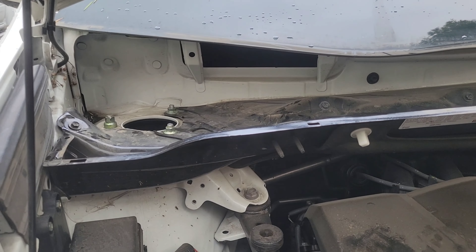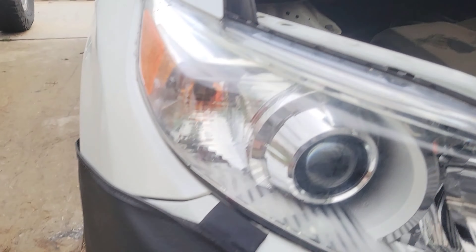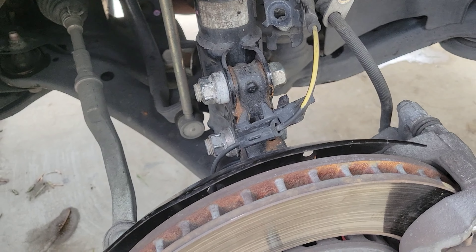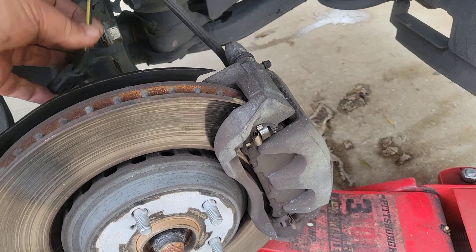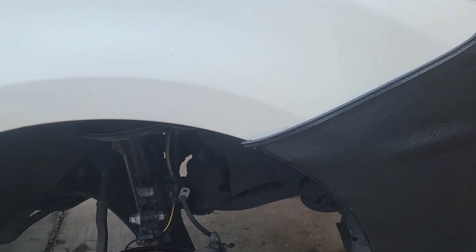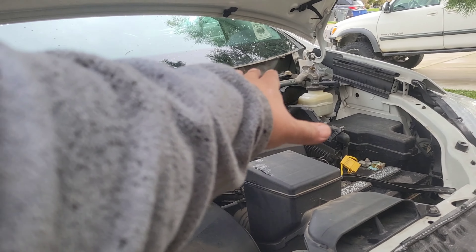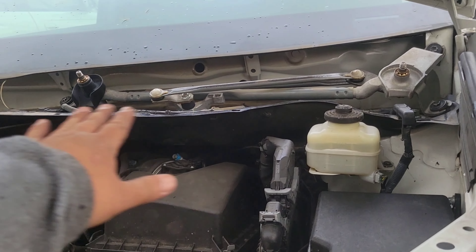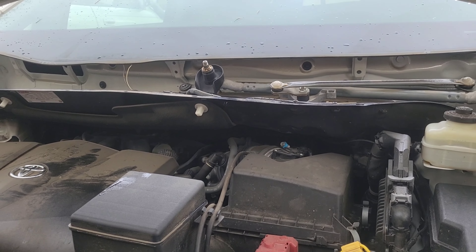This is what we've done so far: torque that disc back — 59 foot-pounds. Then we torque these two main bolts to spec — 155 foot-pounds. We're going to finish putting these little brackets right here back on. Once that's done, we're going to install the black — I think it's called a valence, but I could be wrong — or shield. We're going to install that, then install the wipers, and call it a day.